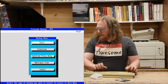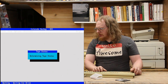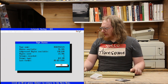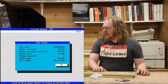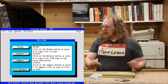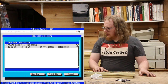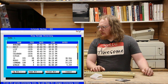So we're done. We have now completed the backup and we can exit out of that. Let's go to Alt, View, and check our tape status — see what it's like. Has it actually saved onto there? Yes, there it is. It sees that there's 190 megabytes compressed available, and we've used just 23 megs. Our last format was May 3rd, 1994 — that's actually because I have the system set to 1994. That's a Y2K problem we're not going to deal with. We've done a backup, and now I can verify the data by viewing the tape directory — and there's all of our files backed up onto this tape.